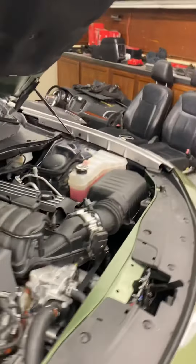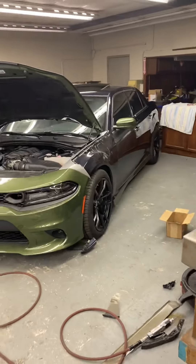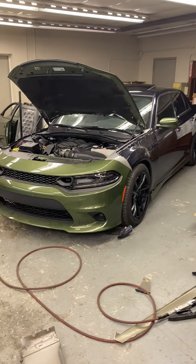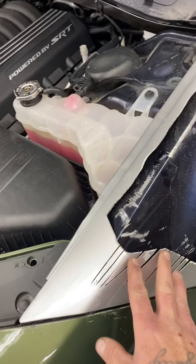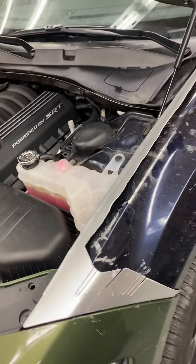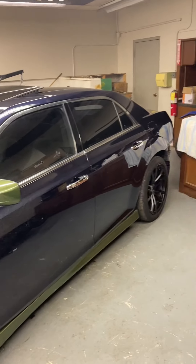It came together nicely. Still got the window man coming — got to put a windshield in it. But I mean, if you look at it, it does look different, definitely something you haven't seen before. I could weld all of this stuff up, seam these fenders together, weld it all up — but it would be a lot of mud in this area here. Even with the pie cuts welded down, it would be a lot of mud to transition everything together, which I don't think would be worth the headache.